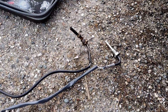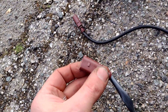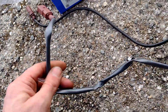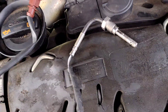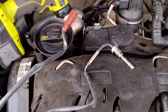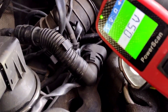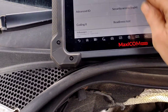There's the new one and the old one. It's the one with the brown plug - the scan tool called it sensor 3. That's the part number for anybody that wants to know. Sensor 3, the brown one, at the front of the DPF right here. It comes with a sachet of grease as well. I'll get that in there - looks like it's going to start to rain so I'll just get this done and check for faults. That's the new sensor fitted, and we've got the 0.5 volts that it was happy with before.